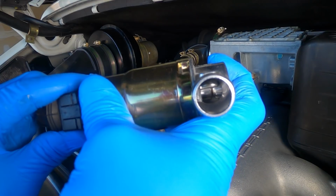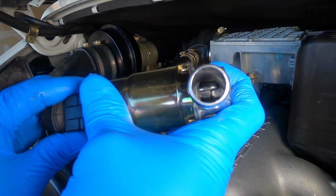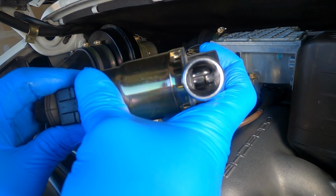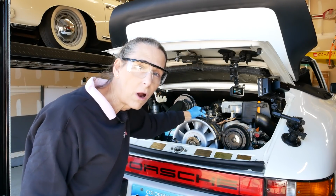It's vibrating, doing the same sort of thing as the other one. The little ticks, tick, tick, tick. It's a little noisier, certainly, but it looks like it's doing the same thing as the other one. It looks like the valve's about halfway closed, which seems about right, and it's just flickering back and forth there. Okay, well that tells me that our part is probably good.